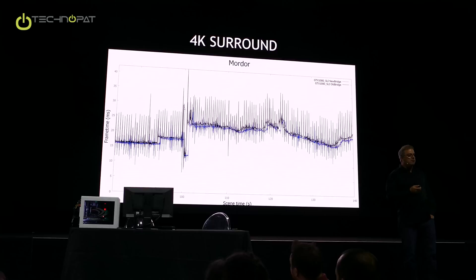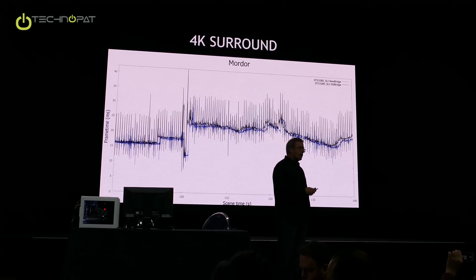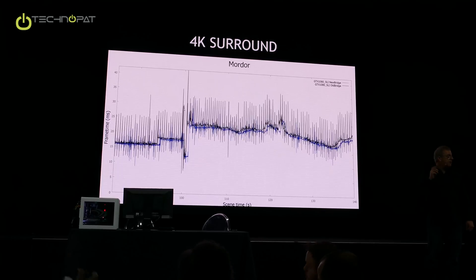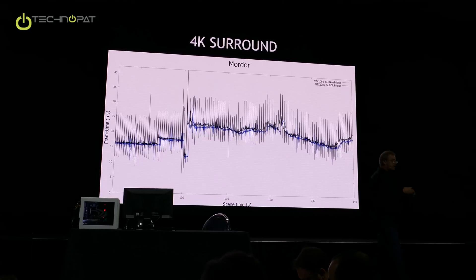So this is a before and after. I'm showing you 1080 SLI on the new bridge and 1080 SLI on the old bridge. What's happening here is 4K surround. We've exceeded the bandwidth available on our traditional existing link, and a lot of people have complained about this experience. This is an FCAT chart — it's looking at actual display time, not like Fraps. You can see the black going up and down; each one is roughly equivalent to a PCI Express transfer. Whenever you're doing a PCI Express transfer, you'll hit bottlenecks depending on your system configuration, creating variation in when you receive the data. With our bridge, all that goes away because it's a dedicated path for the display. You can see the blue line is dramatically tighter, and that tightness gives you a better experience.